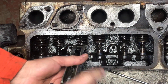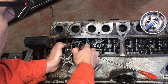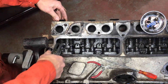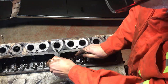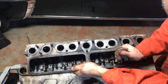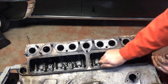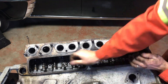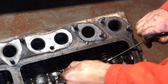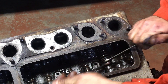Release the compressor tool here. The valve will just lift right up. At this point I'm just backing off the valve tap — the adjustment screws where you're setting the valve lash. I'm just tightening those up, making the distance shorter so I can easily get the valve springs out. All that time you spend setting the valves — it's all undone right here at this point.